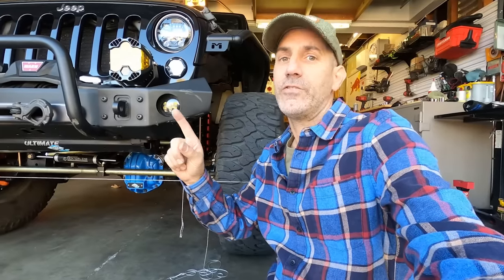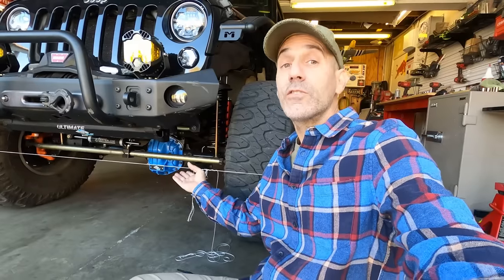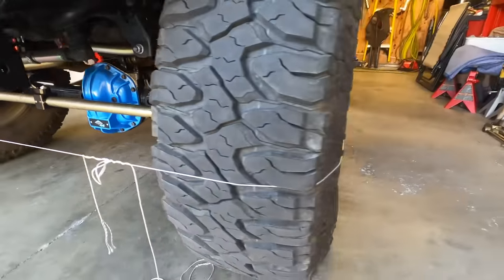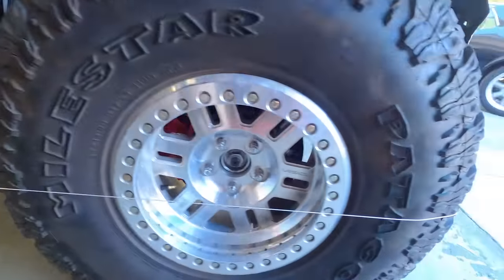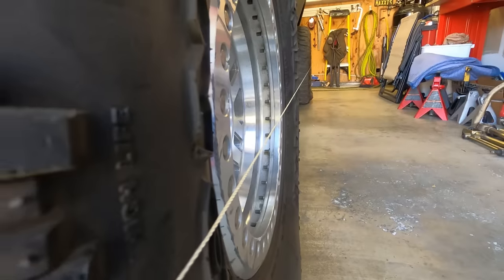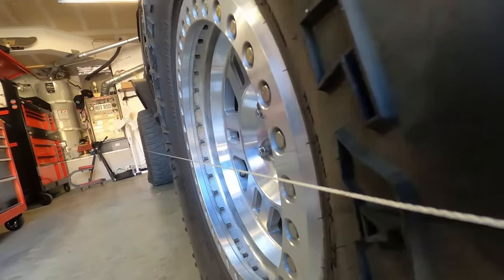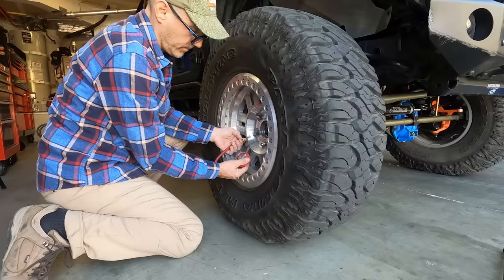Well, howdy. Today it's test drive day. Now, a really cool thing about these videos is sometimes you get these cool tips. I'm always learning. I'm never gonna pretend to be a know-it-all. A couple of cool commenters said, try the string technique for the alignment next time. And that is as simple as it sounds. Tie a string around all four tires, about the center of the hub height. Then you have a very easy visual to compare front to rear axles to make sure you got the vehicle square. And then getting it out of the garage was another thing, so I just decided to drop the air pressure down to 5 psi all the way around and see if that worked.